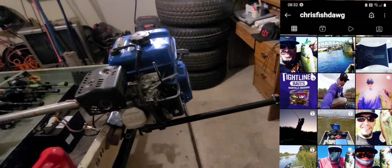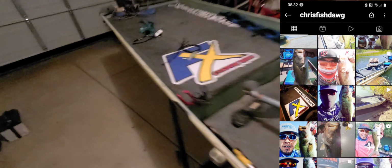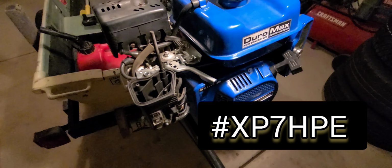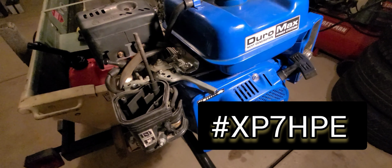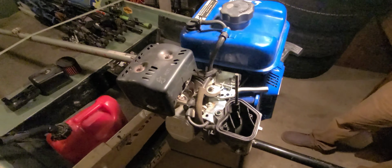So we're gonna be putting a governless throttle setup on him, with one of these Tie throttle cables and Tie levers, because he has one of the older generation Tie kits. We're gonna show you how to set up a governless throttle setup. It bypasses the governor, and makes it really easy to idle and everything else. This should work on pretty much every 212 motor. So we'll get at it right now and show you guys that. It might even do the free exhaust mod along with it.